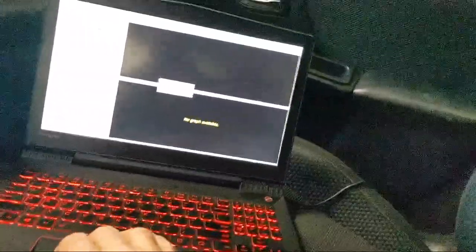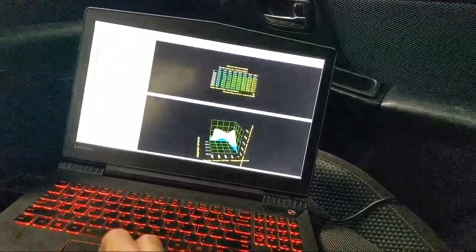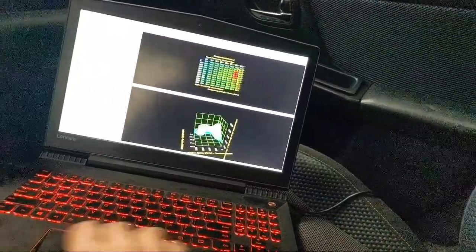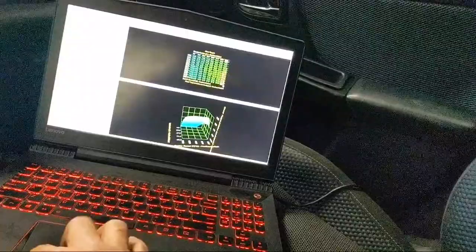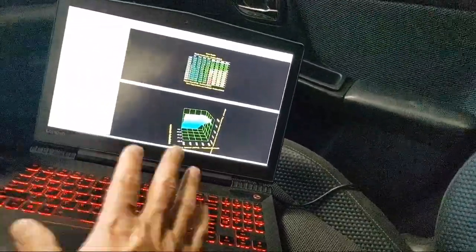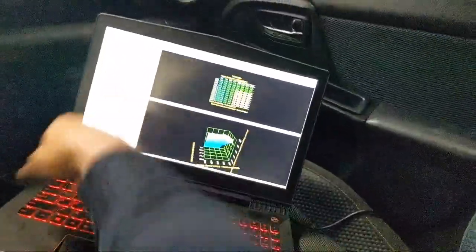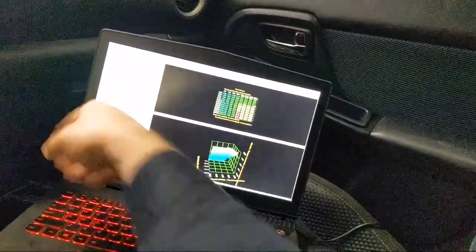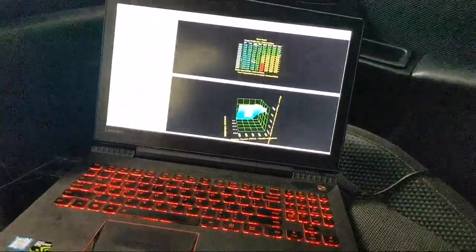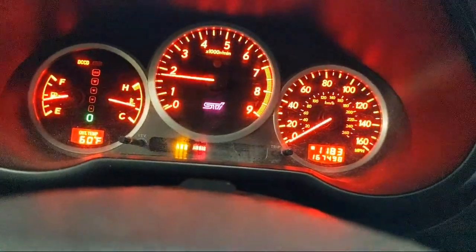That's the only change we're going to make to the car, then we'll see what it does on the dyno and what the boost curve looks like. Before I do that, I have to calibrate the dyno - move it down to speed control, set it to 60, go to 60 miles per hour in the test gear. These aftermarket rubber floor mats are just cancer in Subarus - they overhang the pedals and clip your heels. I've got to select logging parameters: calculated load, commanded fuel final multiplier, RPM, feedback knock, fine knock learning, intake air temp, mass airflow, relative pressure. Wastegate duty cycle to make sure it's zeroed out.